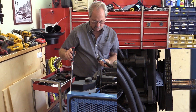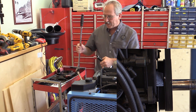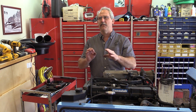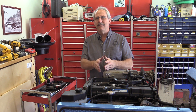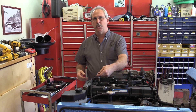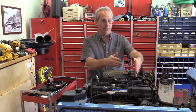I can walk this around until I get to the timing mark — and I'm at top dead center. The question is whether I'm at TDC on the compression stroke or the exhaust stroke. The reality is it doesn't matter, because if I'm on the exhaust stroke, I'm going to have close to 100% leakage — all the air I put in comes out through the exhaust. If I got it right, I'll have a much smaller percentage. Another way to check is to put a hose in and feel for pressure as I walk the engine around, or put a balloon on there — but that takes more work. I've got a 50-50 shot, so if I'm wrong, all I do is disconnect the air, turn the engine one revolution, and I'm set. Or I could move to cylinder four and start from there.